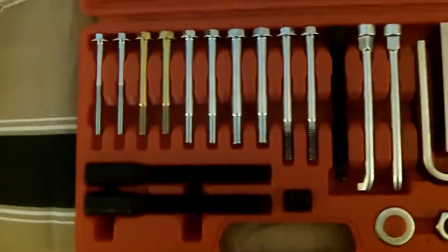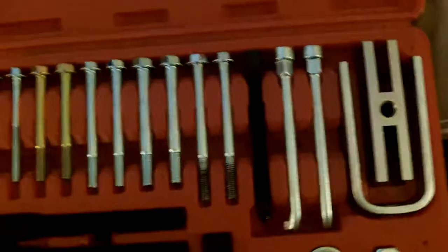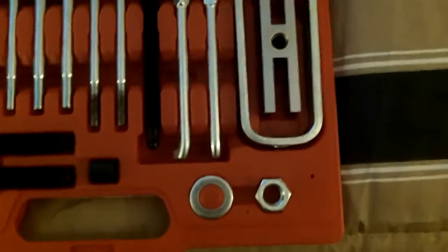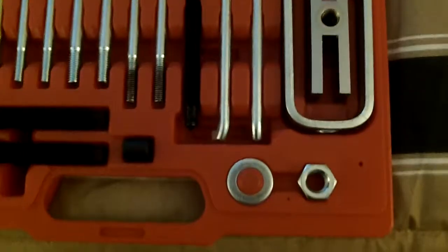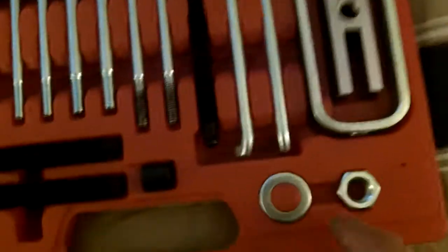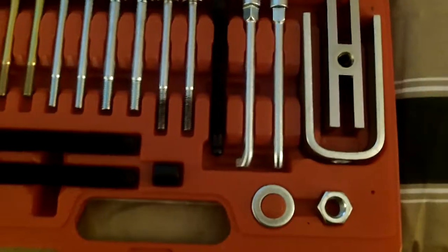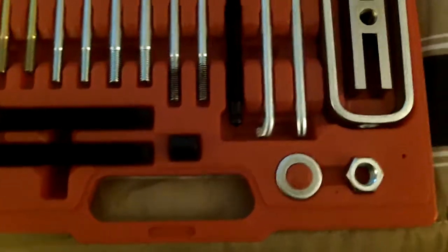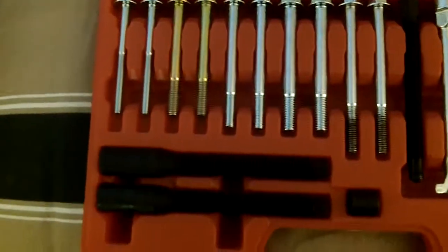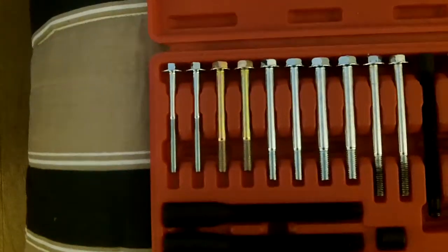And remember, if it's an airbag system, be careful about the airbag because it's an explosive and it can kill you. This, thankfully, it's an '81. It's a C10. It's GM. Pretty much all the same. And you've got the pull-up for the washer and the nut, and that forces the lock plate down so you can get the lock ring out. And there's a lot of videos on YouTube about how to pull a switch to get to it or whatever, but very few about the proper tools.